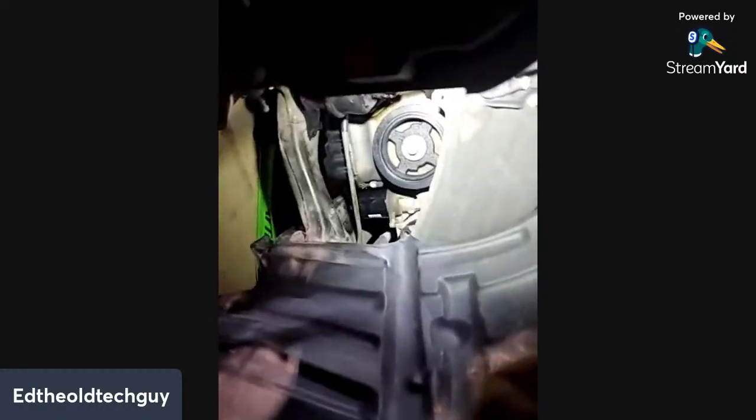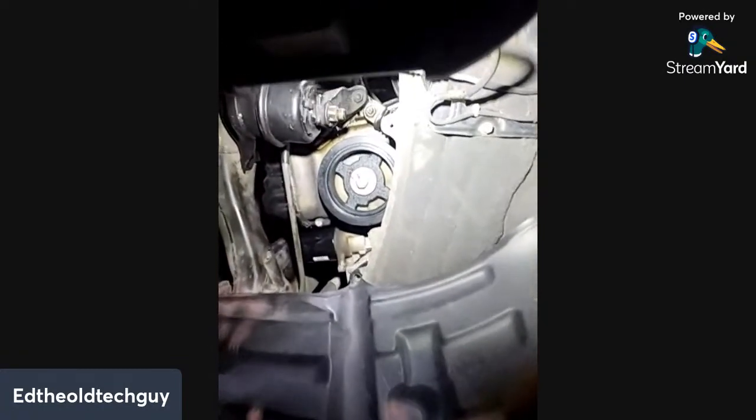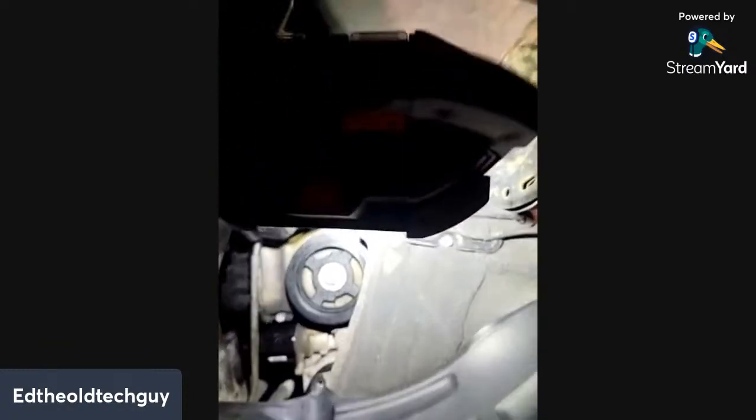I don't think I've worked on this vehicle, or at least, I'd have to be there to get a good view to tell you what to do. I'll be honest, I start taking stuff that's in the way, move it. So what you do is you can run the bolt back in, Ed, and just take a file to it and just get the clearance you need. Well, manipulate the mold.